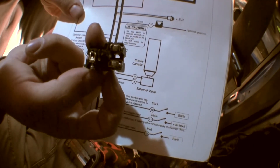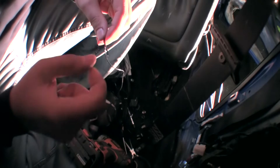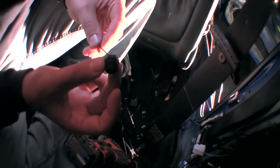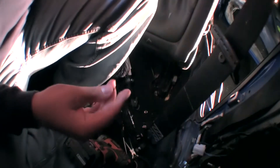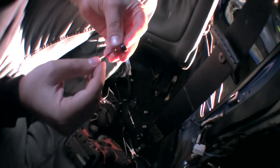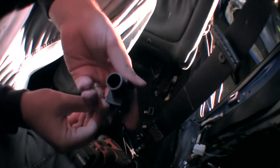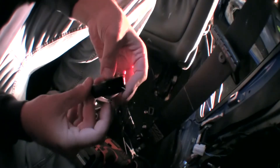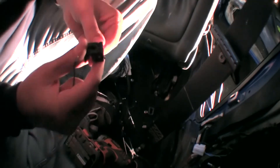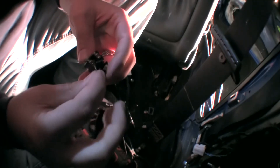Every time we're going to run a wire into this little relay junction box, we're going to have to run it through all the little grommet pieces. So this is the first one, and that is followed by the little washer, then the rubber grommet itself, then the waterproof housing, and then we can find the relay plug part. We're looking for number one, which is this guy right here.